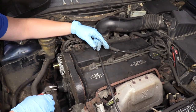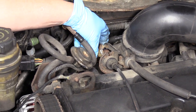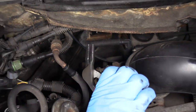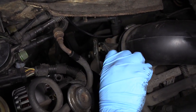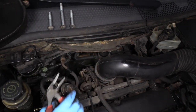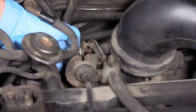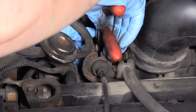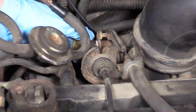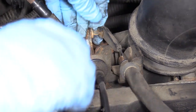We're going to remove the plug wires, but first I'm going to remove the throttle cable and the cruise control cable. If you look back here, this cable is held on with a little C-clip lock clip. With a pair of needle nose, I'm going to grab onto that and just pull it out. Place it someplace safe, and then all you've got to do is just pull this off that pulley. And then this one simply comes off by squeezing it forward.